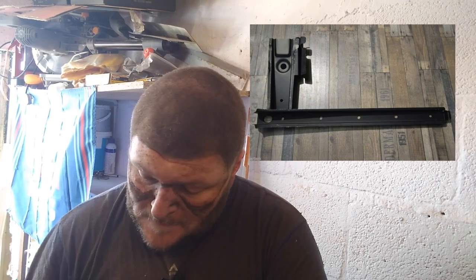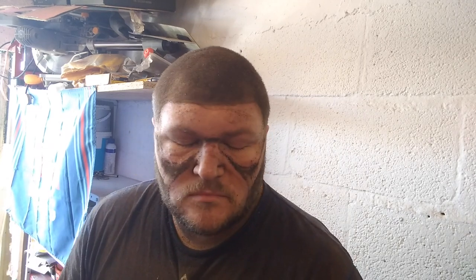The front, I don't know what you call them, but obviously that thing, both sides is gone. More so on the passenger side than on the driver's side. So that'll need attention. The front suspension towers look all right. No, rewind. The passenger side looks all right. The driver's side looks like it's been shot. So that requires a patch of welding. I think that uses the same steel as the bits that are gone underneath the car, the front floors. So I might just buy a section of that steel and fabricate that up myself. Maybe, I don't know.